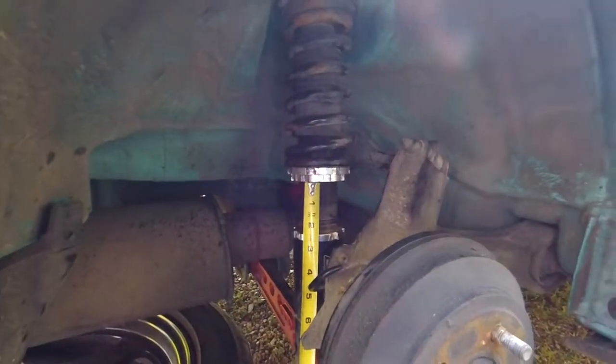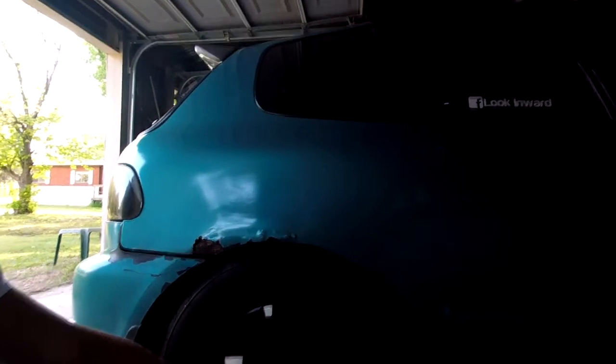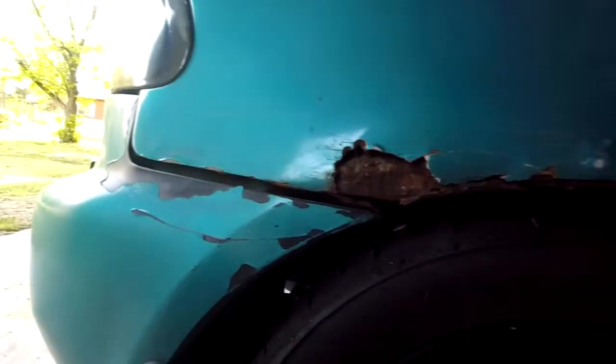All right, the finished result, I went ahead and got the springs adjusted, raised it up, probably about a ½ inch or so. So here's, if you can see what it looks like after. I can get a finger about up in there, so created more of a gap on this end. So it should definitely help. Got to get that rust taken care of.